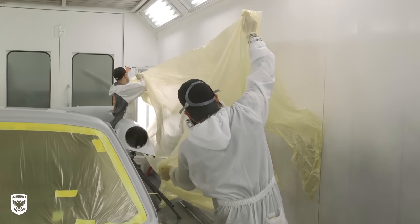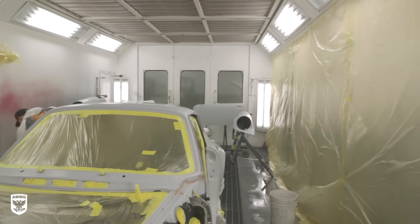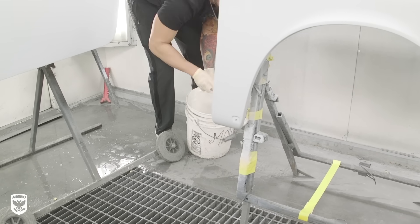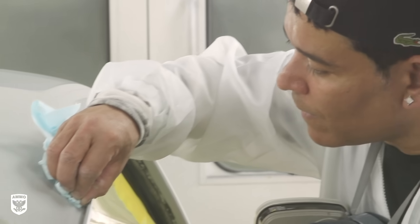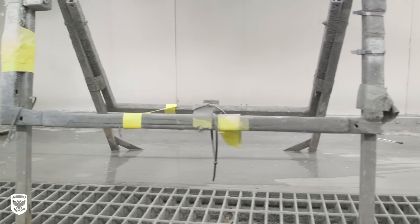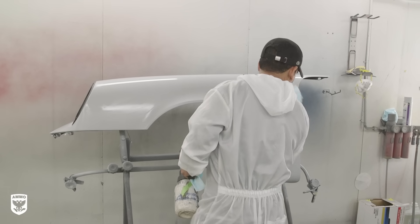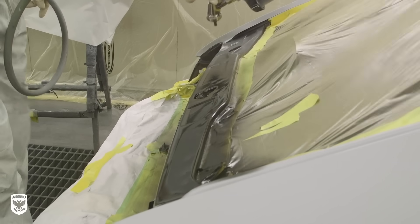With the entire vehicle equally primed, J&B did something I'd never seen before: all the walls were covered in plastic sheets from floor to ceiling, and the floor itself was rinsed down with water prior to spraying any black paint. This technique minimizes the chance of dust sticking to the surface while applying paint — a common mistake most body shops deal with regularly. The plastic sheets attract dust through static electricity, and the wet floor catches floating dust and keeps it from collecting on the car and creating dust nibs.